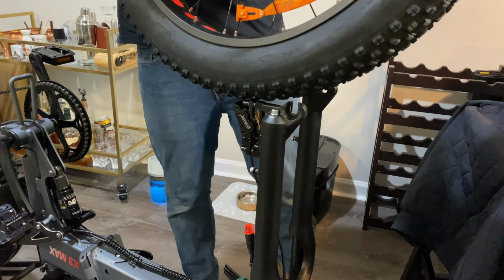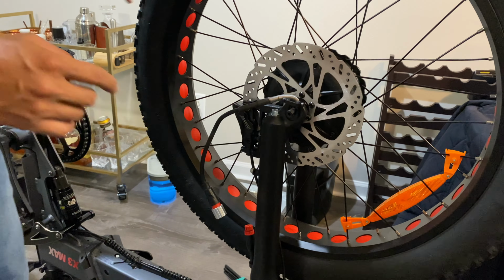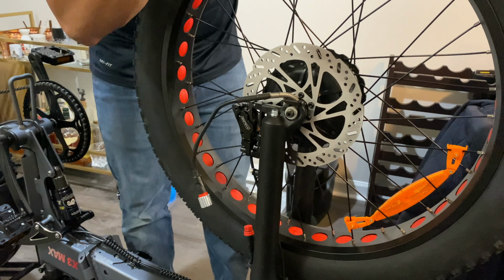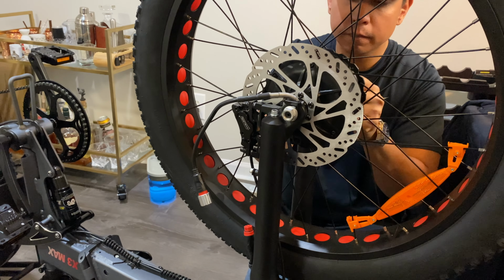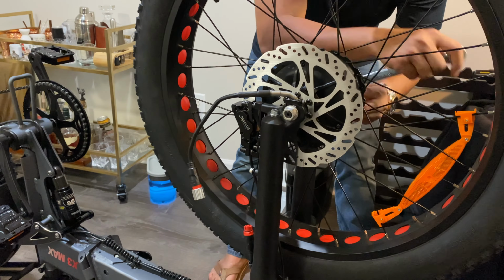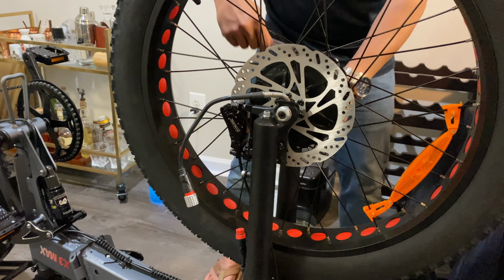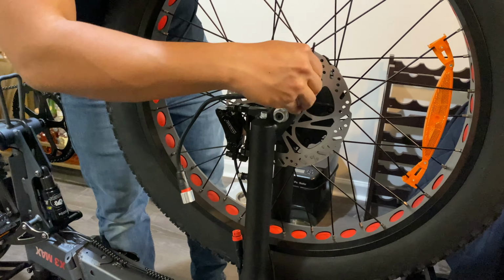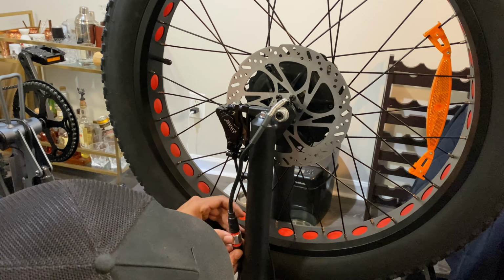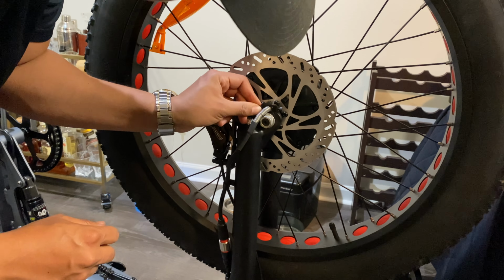Before you install the front wheel, remove the plastic guard inside the brake caliper. Make sure to install the black inserts the manufacturer calls anti-torque washers into the dropouts. Then add a washer and lock nut on each side. Remove the brace on the anti-torque washer to tuck the hub motor wiring under it. Connect the wiring to the matching connector on the fork. Then reinstall the brace.